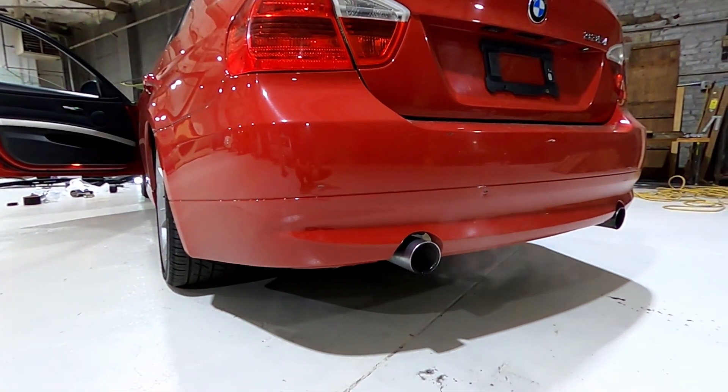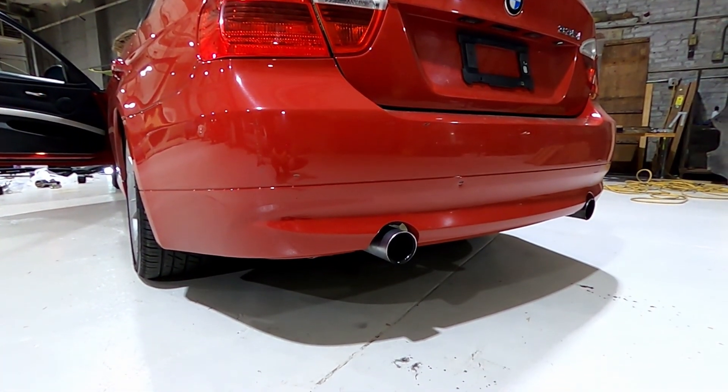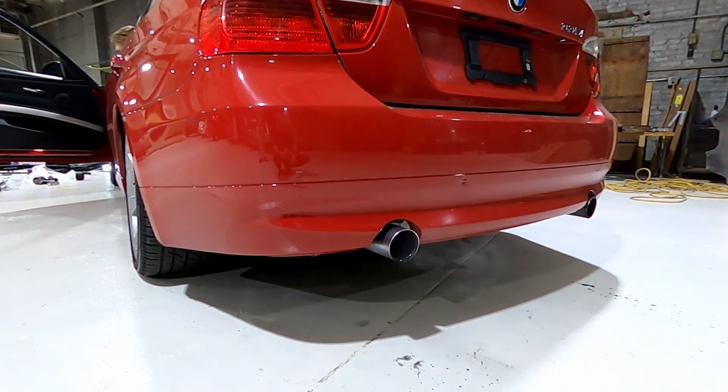Yes, it is doing the burble thing and it's also shooting out carbon. Those spark plugs definitely are making a difference — it feels different than it did the other day. I put a smaller gap on those spark plugs. It seems like a good increase — I like it. I'm not going full throttle. Did you end up connecting those two hoses for the blow-offs?